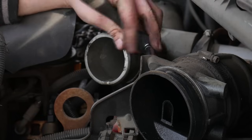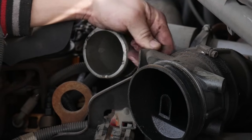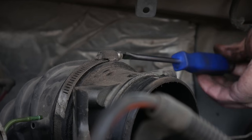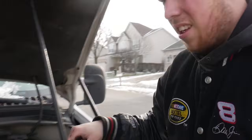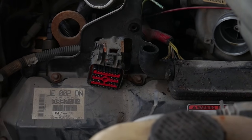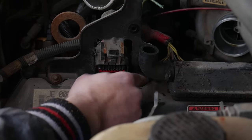We have to remove this — it's the part where the crankcase breather connects to the intake. We just need to move that out of the way so we can reach the bolt under the bracket. There will be a little oil in there — you got the crankcase breather right there, so that's all to be expected. Now we've got to remove these two so the bracket can come out. Unclip the connector to make it a little easier to get to that.